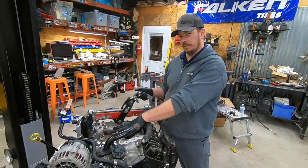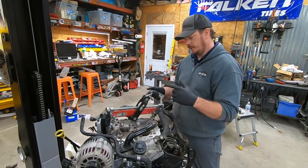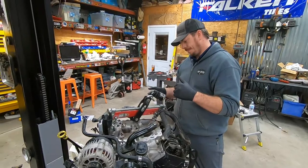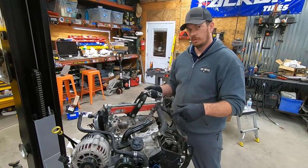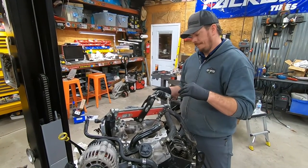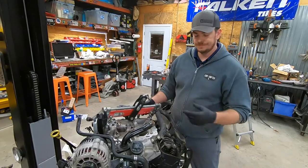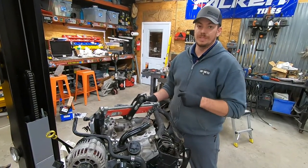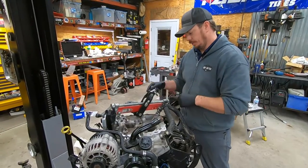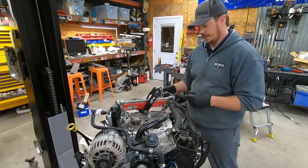But we're waiting a few minutes on the new injector spider. It's being delivered by our parts provider. What I want to do is actually make oil pressure with the starter. The plugs are out. I got the starter on, but we don't have the flywheel, or flex plate, on here yet. So there's nothing for the starter to engage. Can't get it on with the motor on the stand. There's just not enough room to wiggle it in there. I tried for a second.